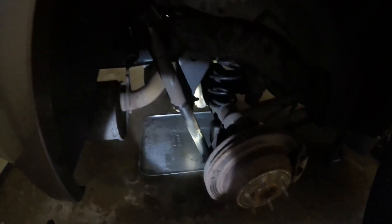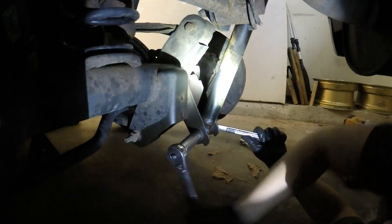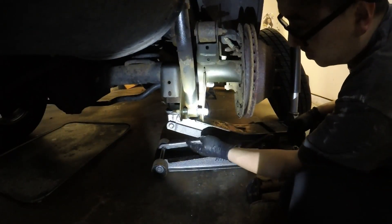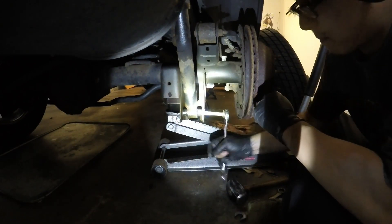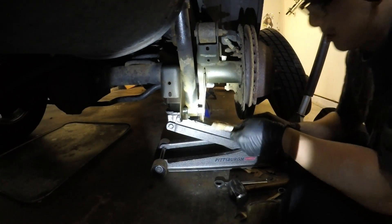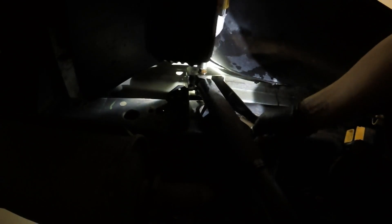It's time to move to the back. Now we're going to be doing the rear — easy, it's just two bolts, top and bottom, and they're going to be 18mm like the fronts were. We're going to get our jack to support the bottom. With the nut off, I've got the jack supporting the axle, and I'm going to pop this nut up. This is possible with a hand tool, but to save time I'm just going to use my impact. But you can do it with hand tools.